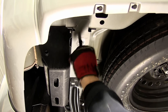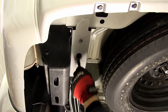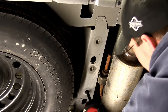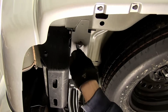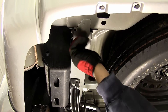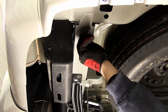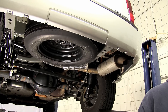For each one of these weld nuts, we're going to spray them down with some spray lubricant and then clean them out with a half inch nylon tube brush, part number 814092. The reason we clean these out is because over time, as the vehicle gets older, it's going to build up with more dirt, dust, and debris that will plug up the threads of the weld nuts. I recommend cleaning it out thoroughly and then taking one of the new fasteners and running it in by hand to make sure it'll go smoothly. Now with all our mounting locations cleaned out, we're ready to go ahead and install the new hitch.